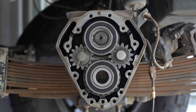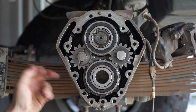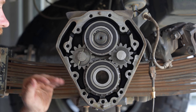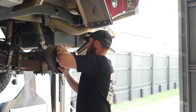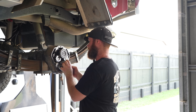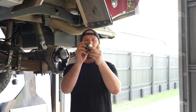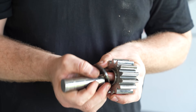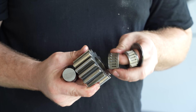So essentially the top line drives everything else, starting driving at the bottom, so you get that four-inch gear drop there. It's relatively simple - there's four gears, there's a bunch of bearings in here, and a little bit of oil. That's it. There's a little planetary gear with a thrust washer on the back and the front, and two little racers inside that. Very simple.